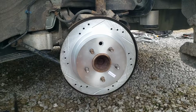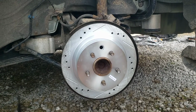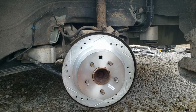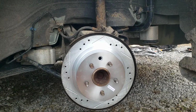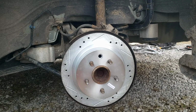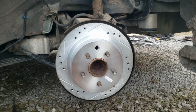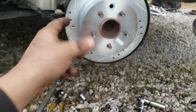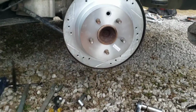By the way, the rotors I buy are zinc plated and they're dry, but a lot of stuff, especially if you get them from the auto parts store, has a tacky grease coating on it, and you'll need to clean that off on both sides thoroughly first with brake parts cleaner and a rag, or your brakes are going to be smoking going down the road and not work. Also, don't touch the surfaces with your nasty fingers, or it'll do the same thing.